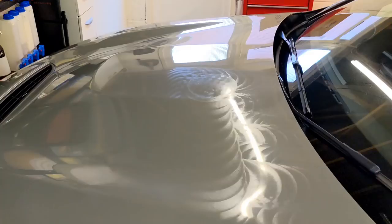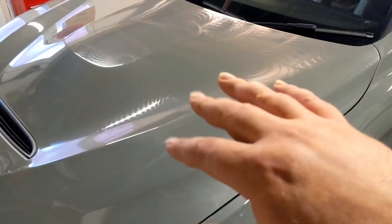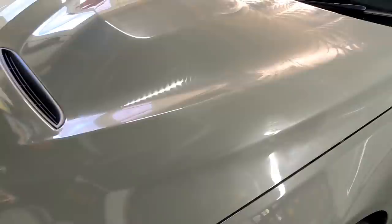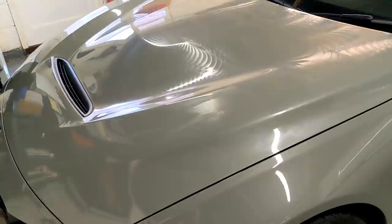Very loose. And I can see here it's starting to dry. So if I had like a Predator Vision mask, all the solvent would be vaporizing away now, coming off out the panel. And that's when the wax starts to solidify as the solvent comes out of it. And then you buff it and it bonds a bit to the panel. Not some sort of scientific bond, but it just dries on the surface and bonds. So if you have an oily wax, it doesn't tend to bond so well. So just wax and solvent is decent.